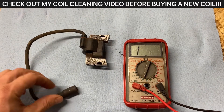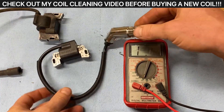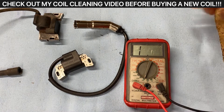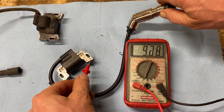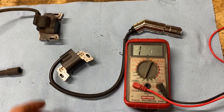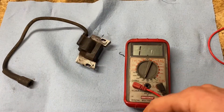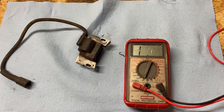This is the same coil I cleaned up in my other video. My big idea was I found a fancy new coil on Amazon — sheathed wire, shiny chrome spark plug holder. It looks fine, and it's listed on Amazon to work with that motor. But when I measured the ohms, shoving the probes in, it reads 9.6, 10 ohms — even 9.3. So even though it looks super cool, if I strapped this on my mower I'd get a weaker spark than the original. Be careful when you order a new coil; research your specific lawnmower and find the correct coil for it.